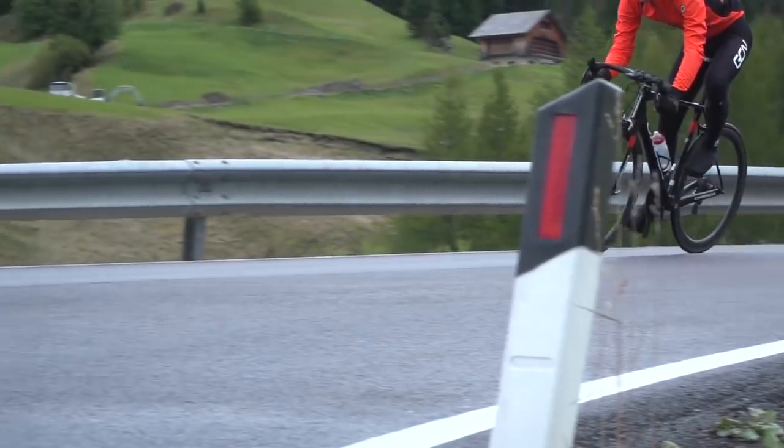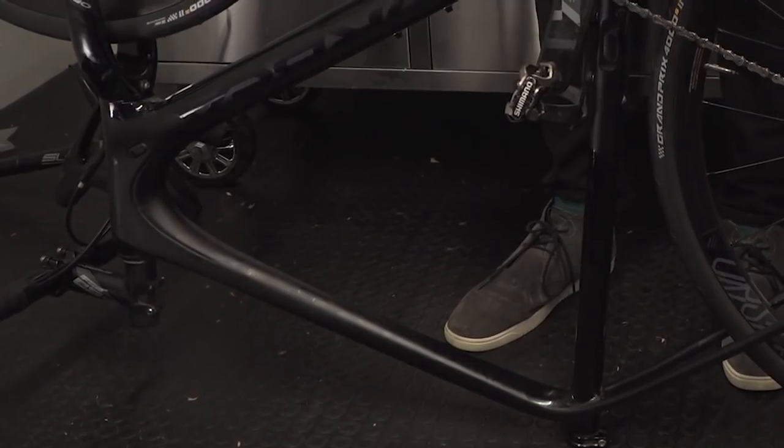Hamish McDonald has got some new wheels and rode them for the first time in heavy rain, noticing they were holding water. Is it common and is there anything to be concerned about? Most deep section wheels do tend to gather a little bit of water in them — it does disappear though. You could put the bike on top of some newspaper to put your mind at rest to make sure the water does leave. Some rims do actually have little drainage holes, so have a look around and you may find them. If you've got clincher tires and you're still concerned, just take off the tires, remove the rim tape and pour it out, or put the bike near a radiator to absorb it.